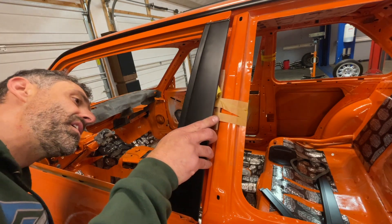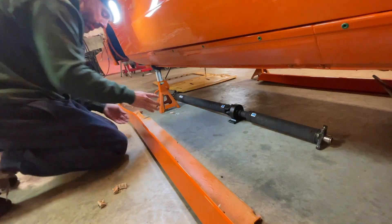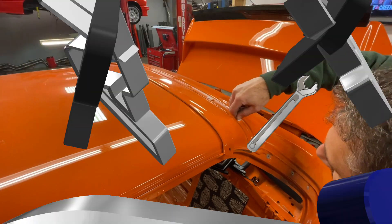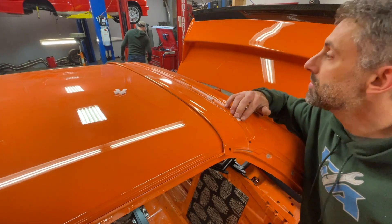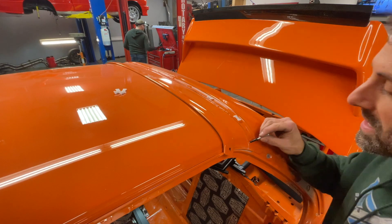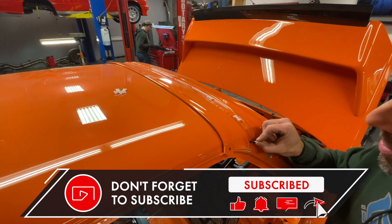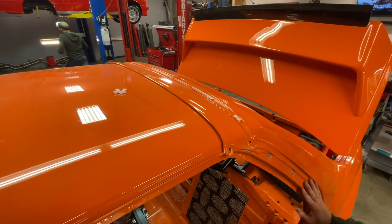We have to finish installing the remaining grommets here, and then this guy just snaps on. Because this rivet is now NLA, you need to use a four or five millimeter — his preferred five millimeter — rivet. Put it in between both of these and pull, and you should be in good shape to have this thing held in place. Then you can start installing the quarter window trim.